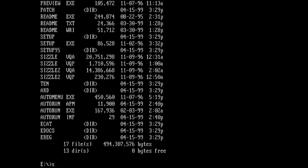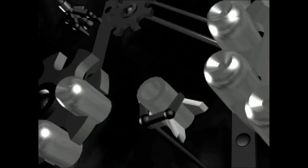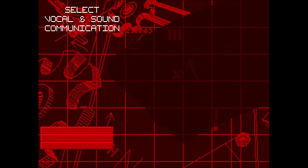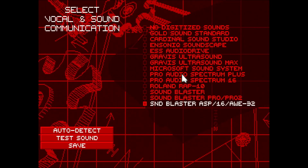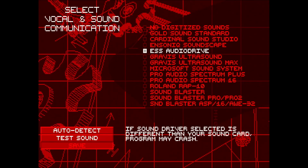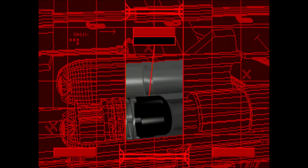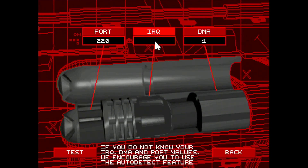Let's try the setup once again. The setup process wants us to configure the sound card. The auto-detection doesn't seem to detect the ESS hardware, maybe because I didn't install any drivers. Command & Conquer Red Alert is one of the games that does support the ESS Audio Drive natively — that's pretty cool. Unfortunately, the sound quality is low. Later I will change to the Sound Blaster Pro setting, which based on the documentation it is compatible with, and the sound quality will be better. Now enjoy this amazing setup process, and I will see you in the next video.